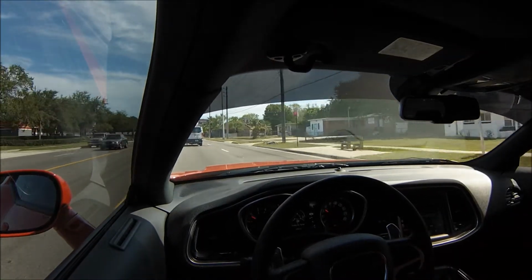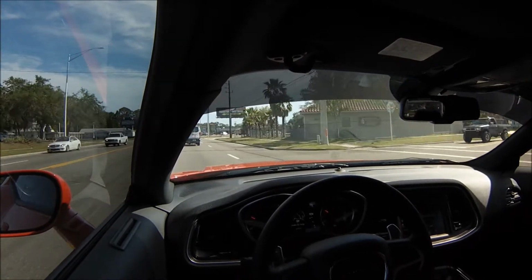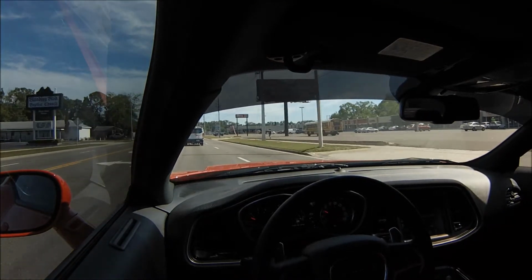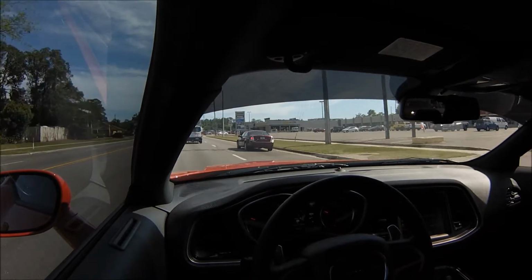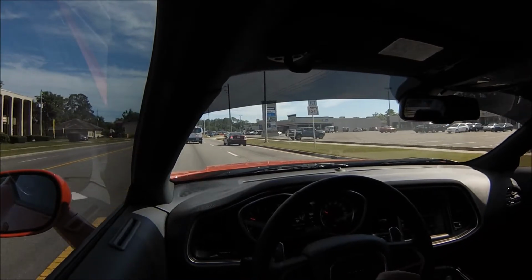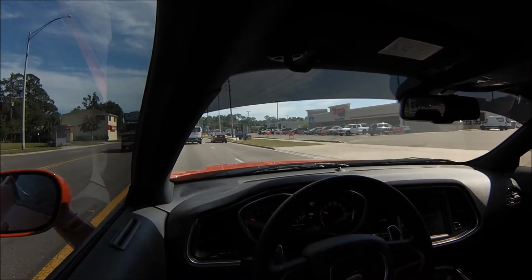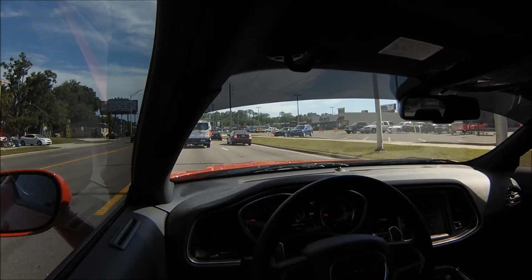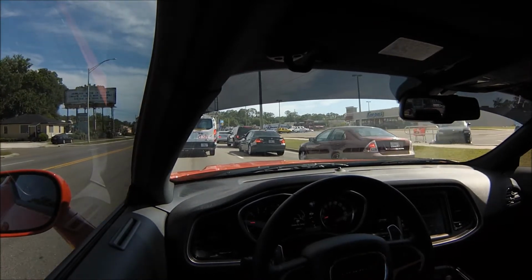But anyway, it does heat up a little faster. One thing I did notice, I was tinkering with it on my break last night at work, and it actually looks like the top of the box doesn't sit high enough for that rubber seal to push against the hood. So it's allowing hot air intrusion across the very top of the box.